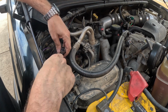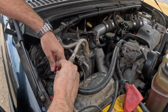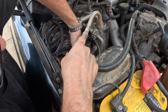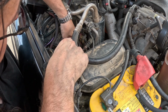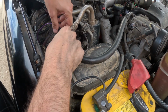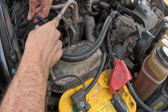And I'm going to seat the new green gasket, and then I'm going to slide the orange connector onto the back. So I got the wires installed in the connector. The O-ring and gasket is on this side. I'm going to put the wire retainer in, so the red piece, which just snaps in, and then we're going to go ahead and connect the air pump or the vacuum pump back to where it should be. So there we go. That's pretty simple. So now I've got the wire that's going to connect to my switch box, and I'm probably going to put the switch box back in.